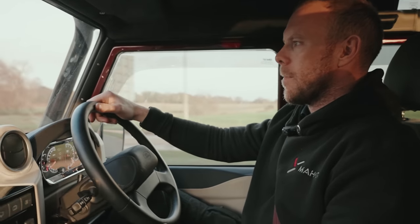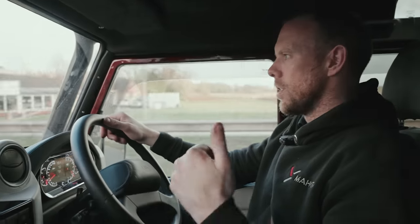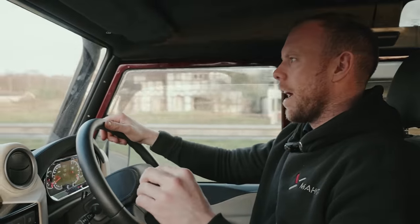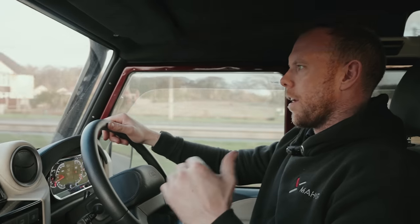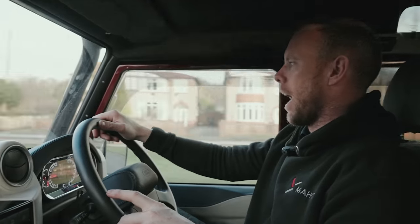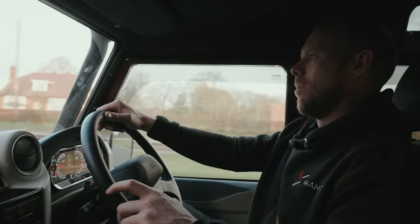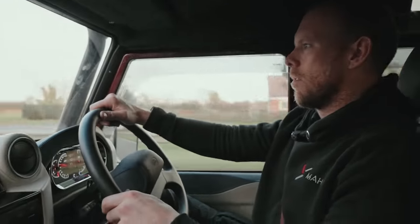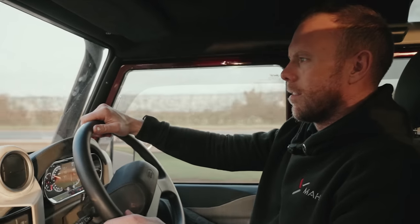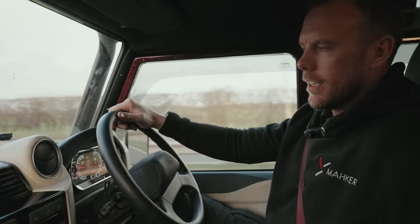It's got our 3-inch stainless steel system, front to back, catalytic converters, you name it, it's all there. It's ULEZ compliant, and on the back, it goes into quad tips. Tom made a beautiful job of making those quad tips, and just listen to this. I'll tell you what I will do, I'll put it in sports mode because this just gets better.